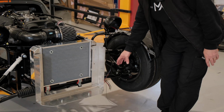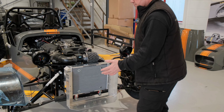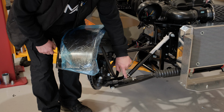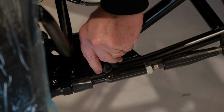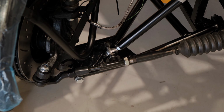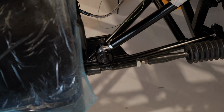We replicated it, and we're on the rack here because we were going to start the geo on the car. There's a couple of things that you have to do as well, making sure that you've got clearances going left to right. So when you put this on full lock, which I'll do now, you're making sure that these components don't hit things like here on the cap. Now as you can see on this one, it's just touching. So what we will do is pop that cap off and just cut that section off there because it doesn't really comply. You can probably get away with no cap, but we put one on as a precaution, and we just leave this top section. Because it's just about touching now, there's two options. You can put a rack stop in, or we just trim the top of this off, because if it impacts there, that will be an IVA fail. So just a little top tip for you, it gets very close in there.